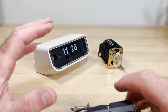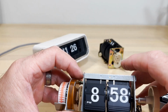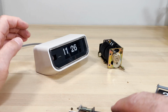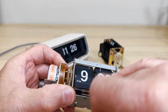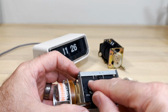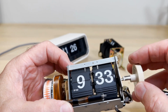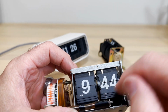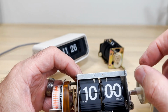So alcohol, and again with alcohol, you say, oh, you can just clean parts with alcohol. I'd be really careful about that. Alcohol causes problems. It can mess up ABS plastic. It can definitely mess up wood grain plastic. So I get away from alcohol. Cleaning tiles, I used to use alcohol. Now I just use plain water and wipe each tile because these are dirty. Now some people never go that deep, but I'll wash each individual tile. Got to go all the way through each individual tile with a Q-tip and just water.